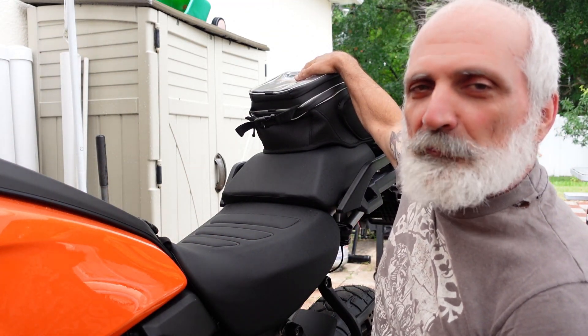I've got this Pan America bag, the tank bag that goes for it. I'll show you how to mount it, although I've already put the screws in so you don't have to watch the pain of watching me screwing a screw. I'm going to show you how to pull off the fairing, quick and easy, and you need to do that to put the front screws in. I'm going to pull the seat off because that's where you put the back mounting strap in. While I've got the seat off, I'm also going to show you how it adjusts up and down — everybody tells you that it does, but nobody actually shows you how the front moves up and down. Pretty simple and pretty easy.